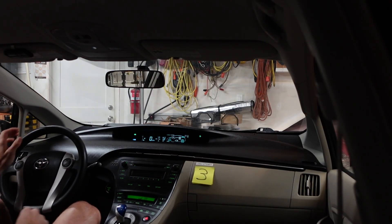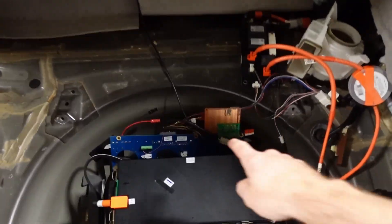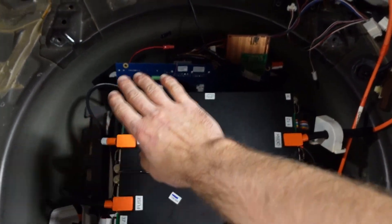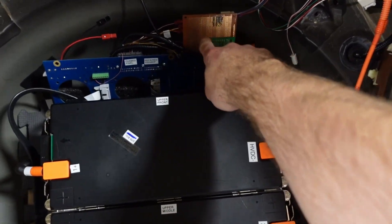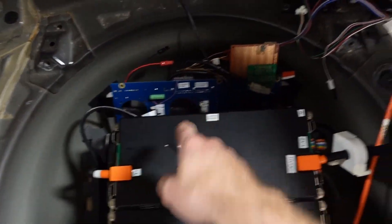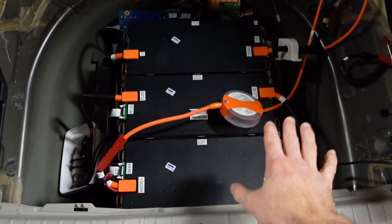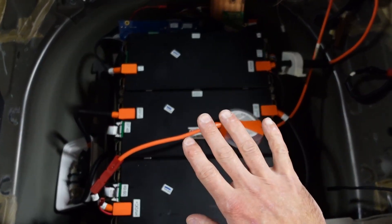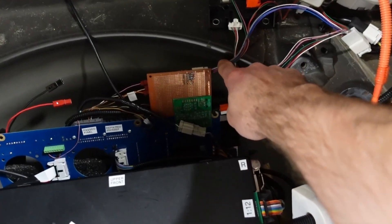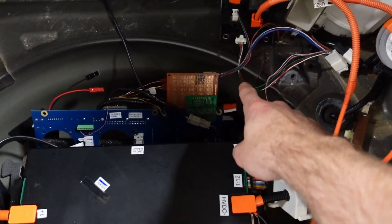Here's the hardware I'm using for the proof of concept - this is not even a prototype. I have the li BCM PCB from the Honda Insight in here. The finished libsu will look nothing like this because it will be the size of the OEM BSU PCB, versus this eight-and-a-half by eleven board. I'm also using a 10.4 kilowatt-hour lithium pack right now - this is the pack out of the Honda Insight that I designed. We're plugged in here to the OEM 10-pin connector, and that is the only electrical interface my product has with the car.